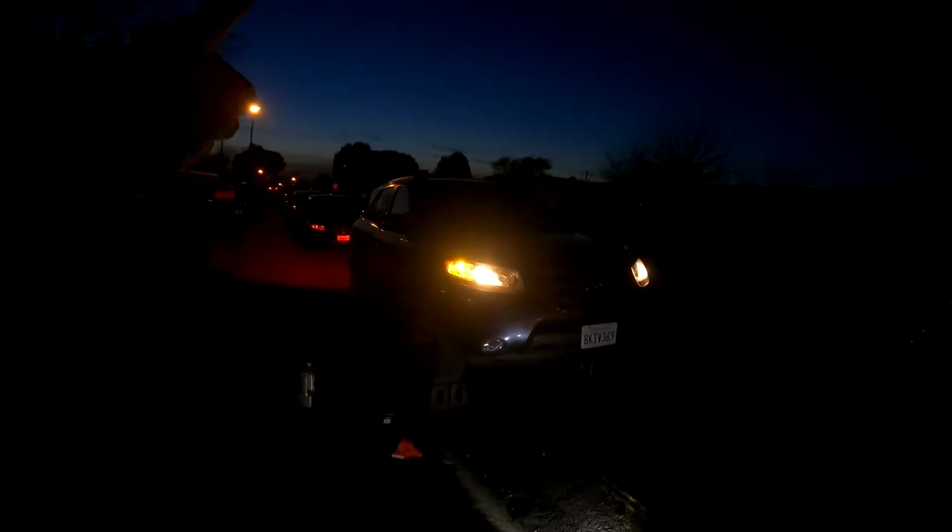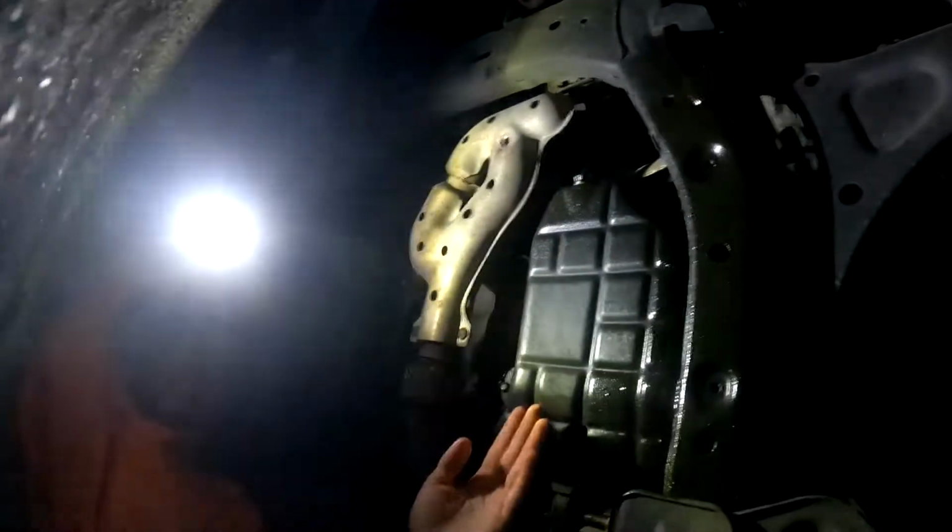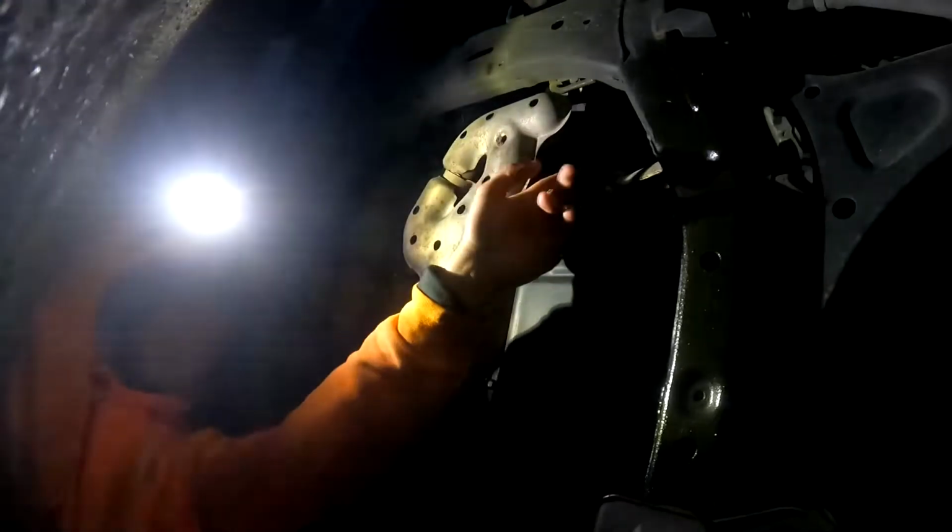All right. He's almost there. You're good. So now my car is on stilts. And for your oil tank, that's the drain plug right there. So it's located on the back of your oil reservoir. Which is why it's okay to put the car on the ramps and have it unlevel, because all the oil is gonna fall back toward this way.